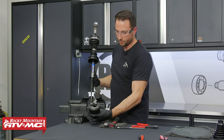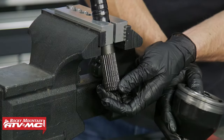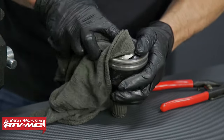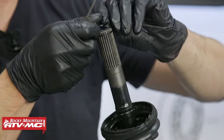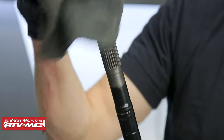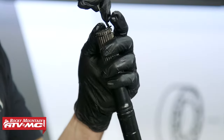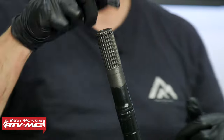Once you have it started you should be able to just pull it off. From here we're going to clean everything up and get that circlip replaced. I'm using a flat blade screwdriver to take that clip off. You're going to take the boot off and get the new boot on before you put the other clip in place. Now if you need to do the other CV boot on the other side as well, you would do it now before you install any of the new parts.